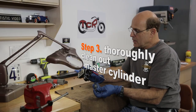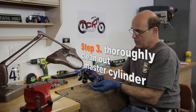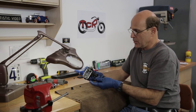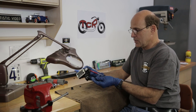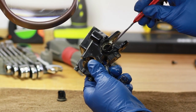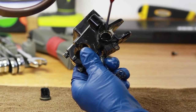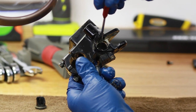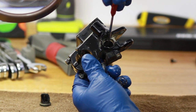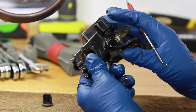So now what you need to do is take a good quality brake cleaner and flush out all the old brake fluid, then blow it out with compressed air. You want to do the same inside the reservoir — clean that out with brake fluid. If you're planning to refinish your master cylinder, this is the time to do it. You also want to inspect the bore and see what kind of shape that's in. Sometimes you'll get a little corrosion on the very end; usually deeper down it's okay. If you have corrosion on the end, you can take a Dremel tool with a small polishing buffer and some compound and just lightly go around in there, shine it up, get that corrosion out, and it's usually good to go.